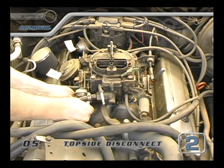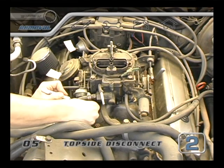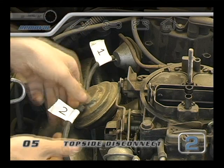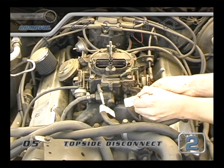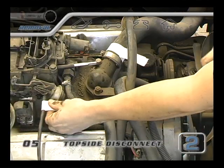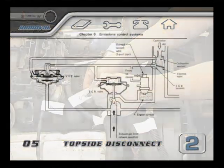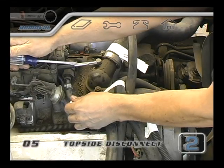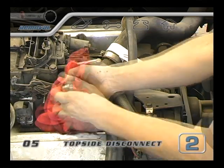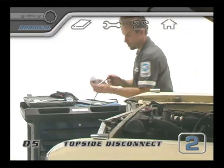After you've put a label on one end of a hose or wire, write a number on the label. Then, next to that number, write down the name of the hose or vacuum line or whatever it is. Also, make sure to label both sides of everything that won't be left in the engine bay. You can also make a note about how and what it was connected to. Look up the year and size of your engine — a good manual should have plenty of details about the different external pieces and accessories for your particular engine. As you pull pieces off the engine, be thorough. This is the groundwork for a smooth installation down the line. One flawless way to make up for a less-than-perfect memory is to take a bunch of pictures to go along with your notes.